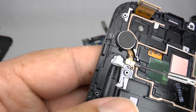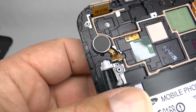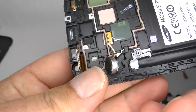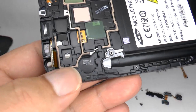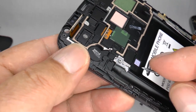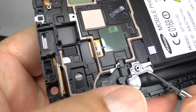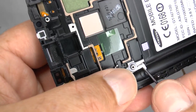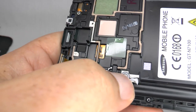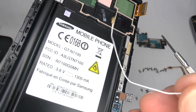You might need to transfer the vibrating module over to your new screen. So gently lift up the circuit board — double sided tape is holding it in — and then using a small pointed instrument or screwdriver, gently lever the vibrating module out from the casing. Now you might need to transfer this little rubber cap for your S Pen. Just pull that out — a little bit of double sided tape holding that in — and transfer that over to your new casing. There's a small plastic clip here that gives it a clip in and clip out, so again transfer that over to your new housing if it doesn't come with this little plastic clip. Now remove the 3G GSM antenna flex from the casing and put that aside.